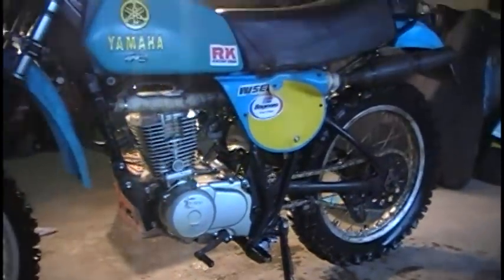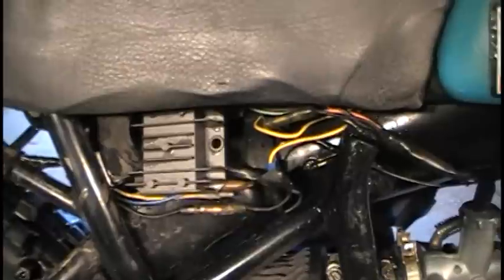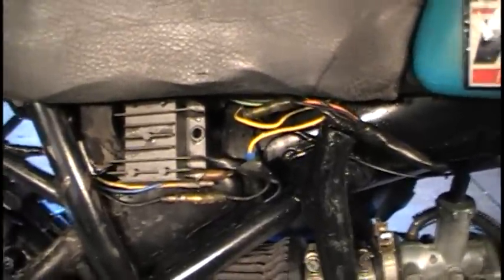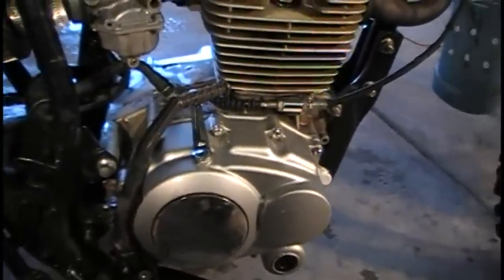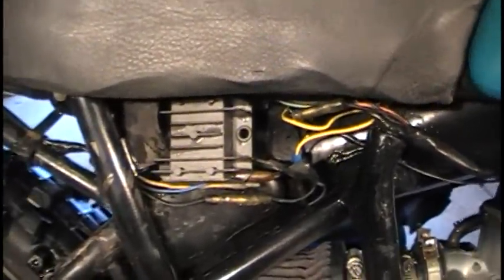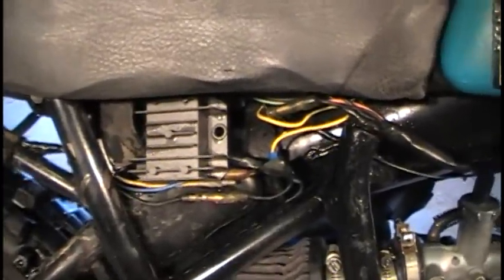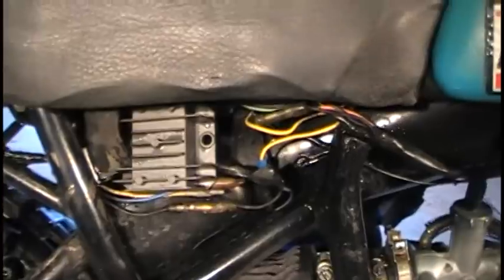The last thing I did: this bike used to be a six-volt system running off a generator right on the engine. It turns out this Honda clone engine has a generator built in — I noticed when hooking up the CDI box there were three extra wires. I figured it had to be some sort of generator system but didn't worry about it until I got everything running. Once running, I put a voltmeter on it and confirmed: yes, there's a generator — two wires for the generator and one for ground.